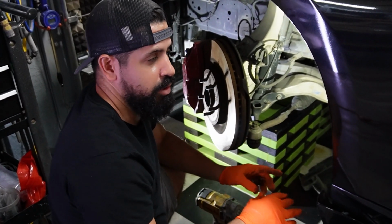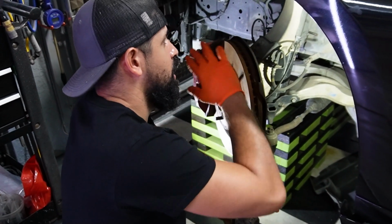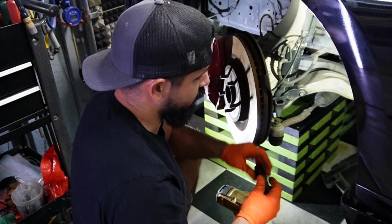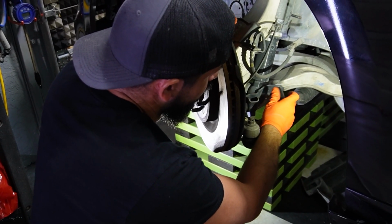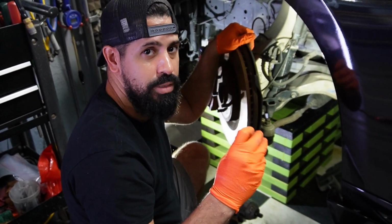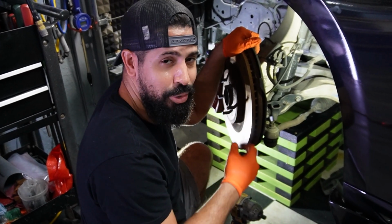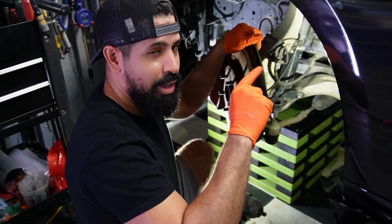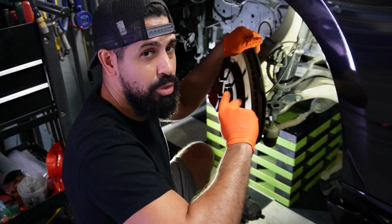All right guys, I just want to share this with you because I just discovered it as I'm removing these struts. I bought this vehicle used about a year ago. It came with everything that you see here except for the wheels and the exhaust. I installed that. Now I just discovered this. I have the socket right here and I was trying to check the size and I spun it by hand and this bolt is completely loose. Why am I showing you this? Guys, remember, when it's time to put everything back together, make sure you put a wrench on it and tighten it, because you don't want any of this stuff coming loose while you're going down the road. I have found a lot of that in this vehicle. At some point I'll probably take everything apart, engine-wise, everything, and go through it, because who knows what else I'm going to find.